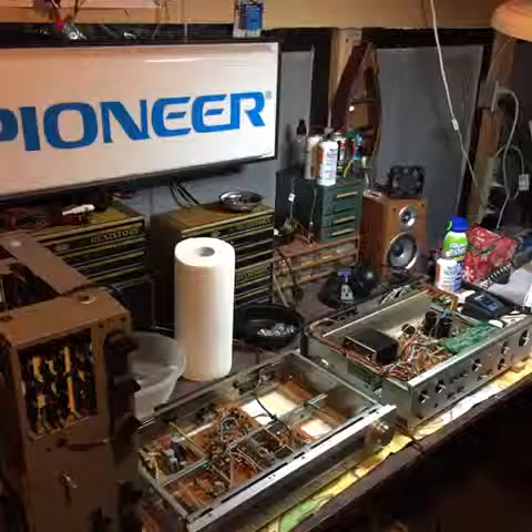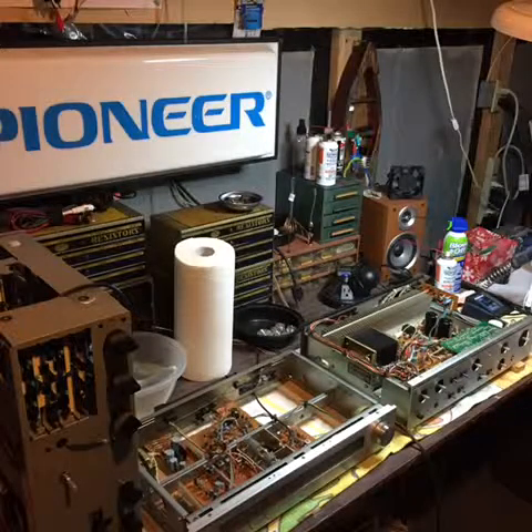I had to disassemble and scrub them — look at that water turning yellow. I disassembled them, cleaned them thoroughly including the boards, used DeOxit to lube the controls, and tested them — not just once, twice, but three times before I actually got them sounding half decent. Today we're going to talk about that journey and whether the Luxman of the 80s, particularly the L-series amps like the L450, are worth collecting and listening to.